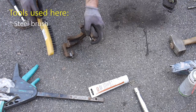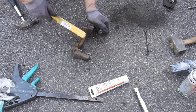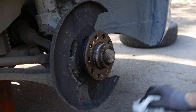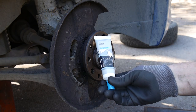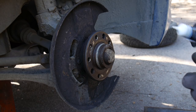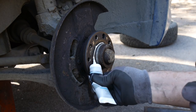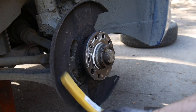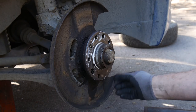This would be a good time to pick up the steel brush and clean off any excess dirt or rust from the caliper mount, mainly to make sure that the pads can move unobstructedly in the grooves and work smoothly. It's also a good idea to wipe the rotor mount plate clean and basically give everything a rundown while you have it taken apart. I even used a bit of anti-seize to prevent them from getting stuck again. If you disagree with this or anything else in this video, please drop a line in the comments section, preferably with an explanation as to why.